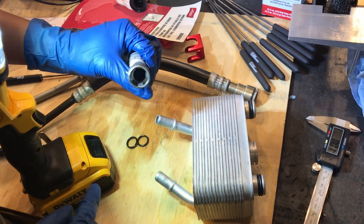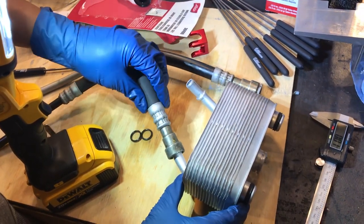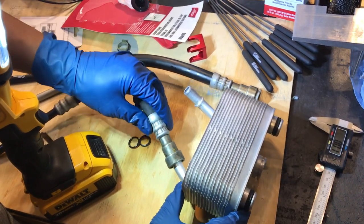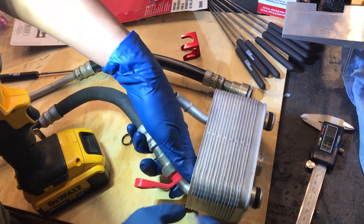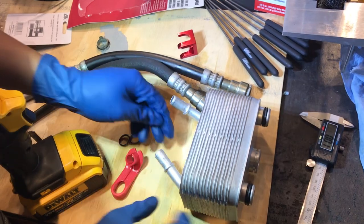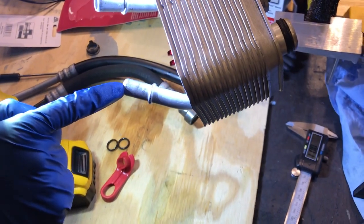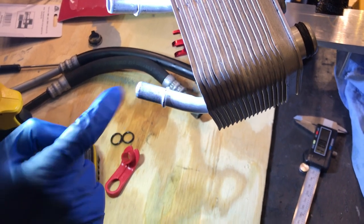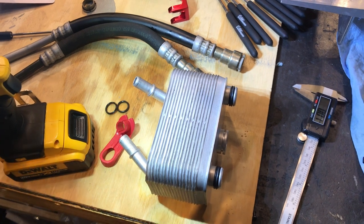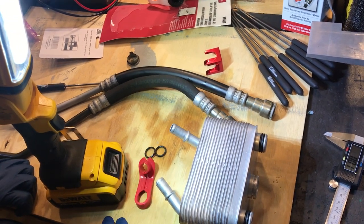Replace those o-rings, drop them back in there, and you should be able to use these cooler lines again no problem. Just for fun, let's put it on with no o-rings — look at how much it wiggles! There's so much play because there's no seal in there. That really underscores the importance of those o-rings. Looking inside you can see the mark where one o-ring goes, and down here where the other o-ring goes — it's a double seal. At least BMW or ZF, whoever designed this, had some redundancy in the seal.